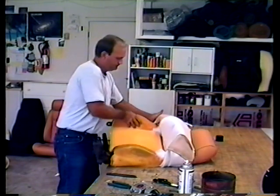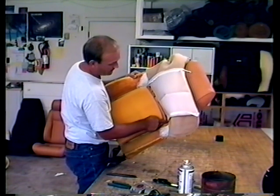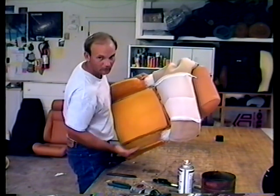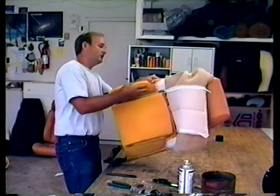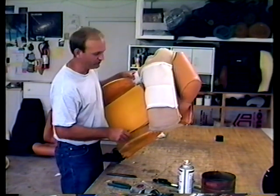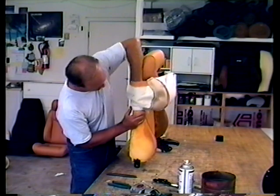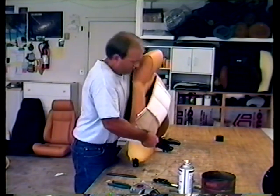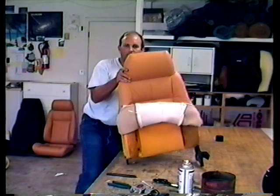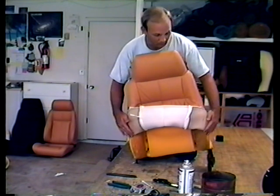At this time I wanted to show you — level with the top listing and the one in the middle of the seat, there's a little loop right here and over here. That's where the rods slide up under. Because the backrest has a back, this is a little bit more difficult than doing the cushions. Slide the seat down. Just make sure that these seams are landing on the high points of the bolsters, just like the bottom.